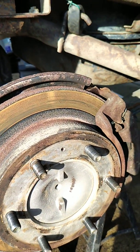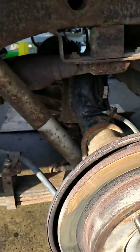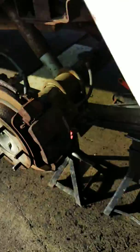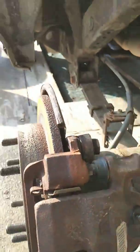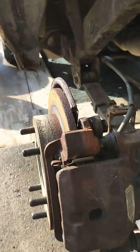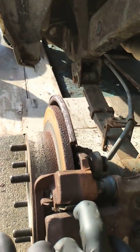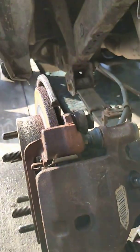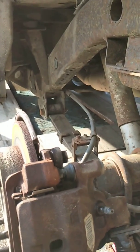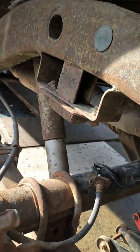This equipment isn't completely beat — I've seen worse. There is some pad on this side, but we're getting lower on the other side, the passenger side. With a good cleaning I can tell that Goldie definitely could use some undercarriage protection and rock guard. To inspect the brake pads, I've gone in with a flashlight after getting the wheels off and cleaning everything off. I'm very leery of asbestos dust. I focus the flashlight beam to a pinpoint and get in there to look at both sides of the pads — checking for uneven wear, whether clips are out of place or missing, how the bleeder nipple looks, and how the slider arm and spring mechanism look. I'll probably need new cotter pins when I change these calipers out.